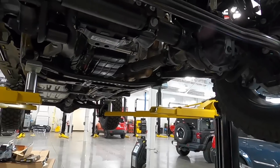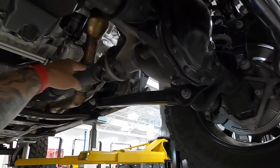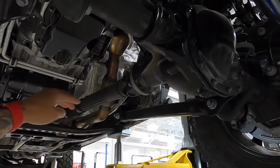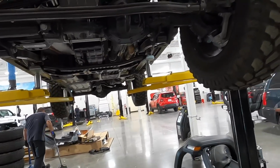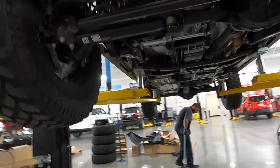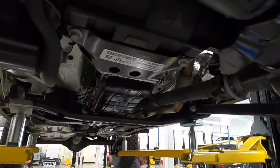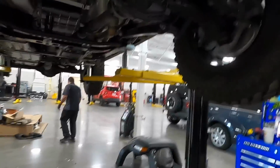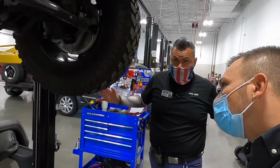Yeah, because I was watching some YouTube videos. Once you lift this up about 4 inches, this is no longer straight. So does all this get aligned? Correct. What happens is, even a 2-inch lift is going to have a different short arm in the front, because anytime you lift a solid axle vehicle, you actually shorten the wheelbase. So to counter that, if you're going 4-inch, you're right at the place where you do a long arm, so it stretches that back out.